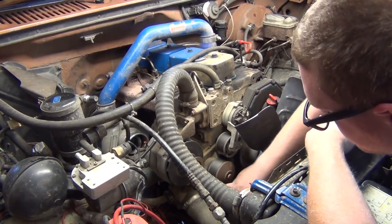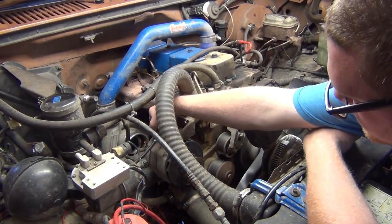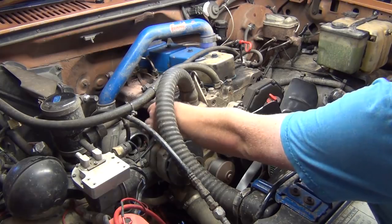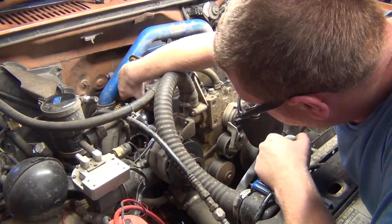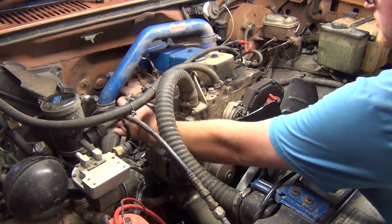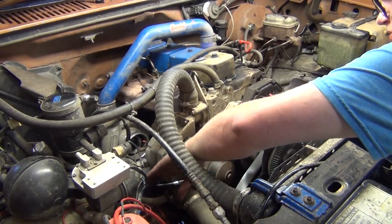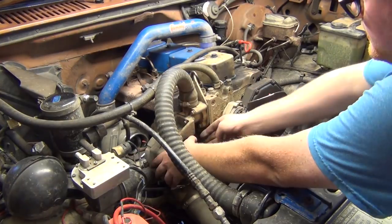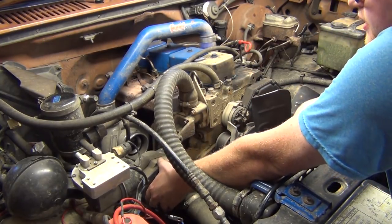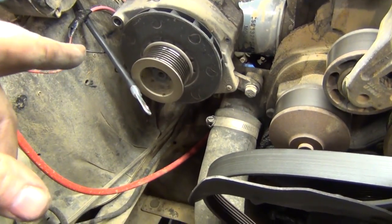And it's time for a front cover gasket, and I got a split open gasket here. Whoopsie! Okay, so we'll get this undone. I think I can get in there with my electric gun and zip that off. Get the alternator moved over, and we can zip these 8mm bolts out of here. I think I might take my alternator out completely. Lay over. I don't have the bottom part very tight. So it should sit something like this.